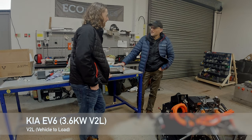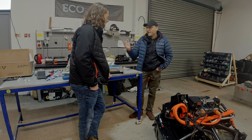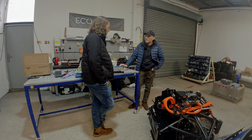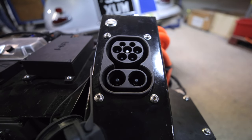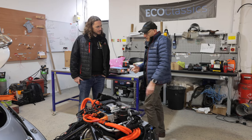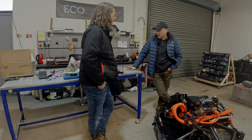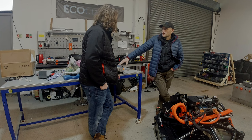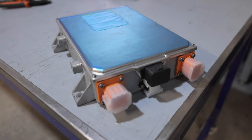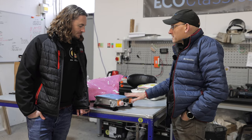It'll do about between four and five kilowatt AC out. So we're starting to fit this into things like Land Rovers — you're in the middle of a field somewhere and you want to get out your tool, boil a kettle, run your fridge, or use a chainsaw. We have that capability now. You charge through the normal Type 2 port, but you actually come out through the Type 2 port as well. You'd need an extension lead that comes out and pulls it out to a fused three pin. We've moved to this one because it's got so much more functionality and it's about half the size of the original charger — reduced weight and easier to package. Everything that we build now has this charger in it.